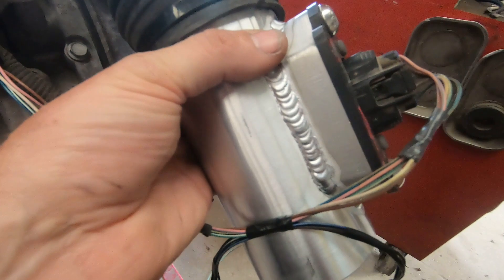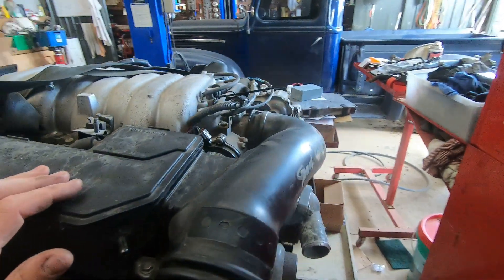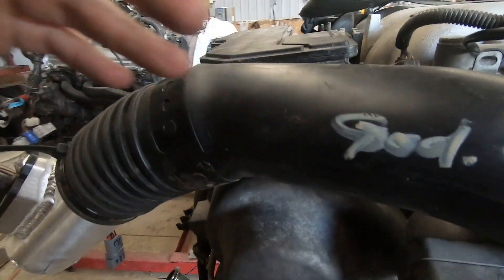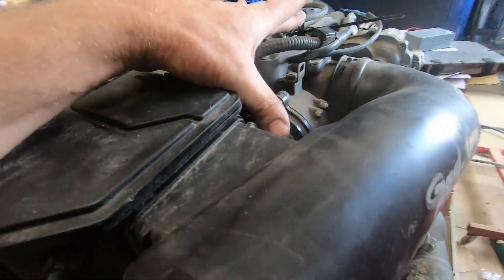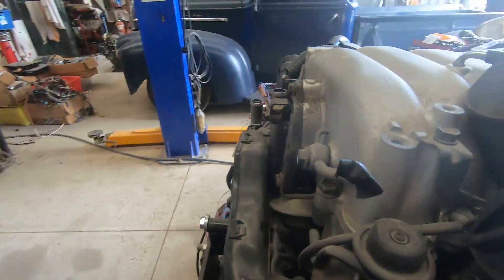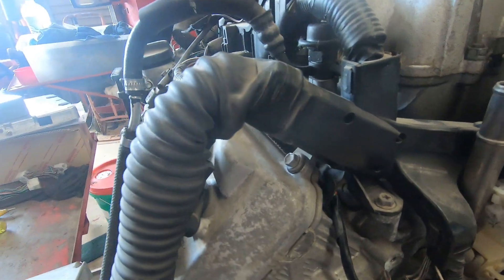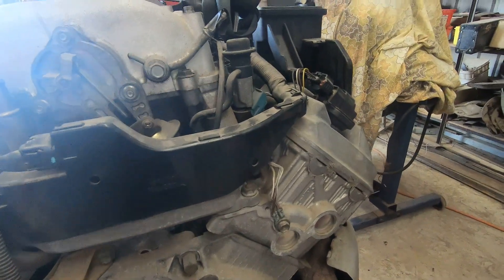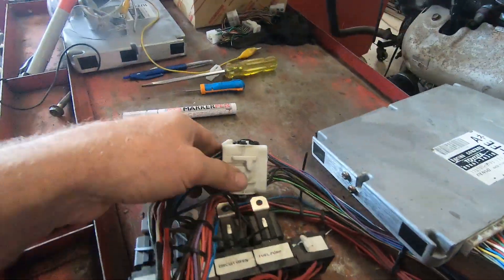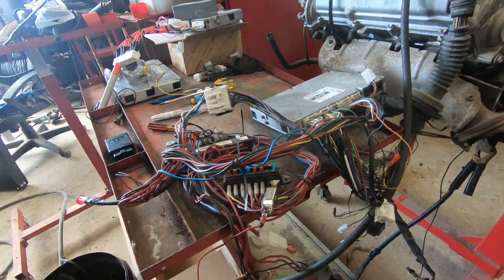The airflow meter — I've put my adapter on it that I make and it's got this airflow meter with the wide bolt spacings. It's actually had a 3UZ fitting housing, thermostat housing, which is another difference on the 1UZ over the 3UZ. Hydraulic fan on this one at the moment and the throttle body with the throttle cable, but as we know from other videos that is a drive-by-wire throttle. The loom on it comes out the back of the engine. So this is off either a 20 series or a 151/150 series Crown. There are differences between those looms. The 20 series has this big — I believe it's a 26 pin — body plug, whereas the Crown has several smaller plugs.